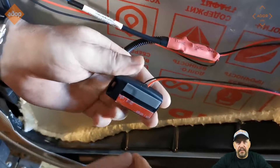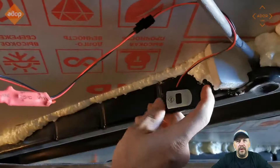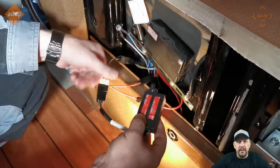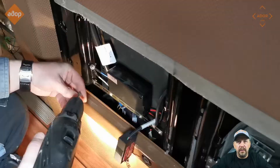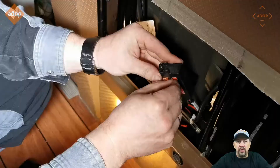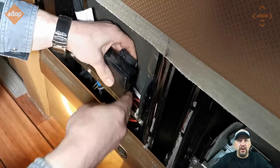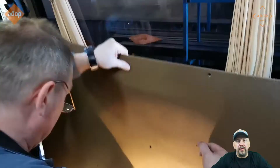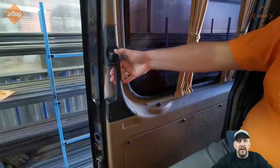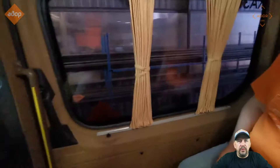There's double-sided tape on that remote, and it's connected inside the door permanently. Also connect the receiver that comes with the hardware — double-sided tape, also connected to the controller. The controller is the part of the automatic door opener that controls your door: opening, distance, and speed depend on what kind of opener you have. Fix it permanently. Before you put the cover on, make sure that it works. Then when you finish putting the door cover back on, this is how it will look.